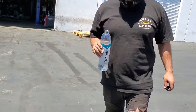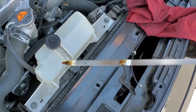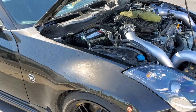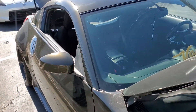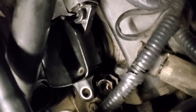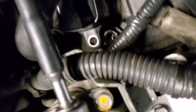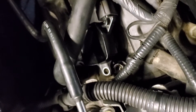What the hell is wrong with you man? There's like nothing on there. This one here came in like this — the coil pack has no bolt because somebody had already messed up the thread and they glued on like a nut on top of it. But it doesn't matter because it's gonna push the coil pack up and it's not gonna make enough contact.